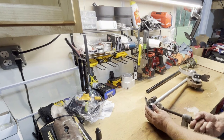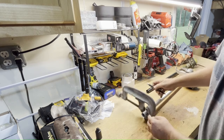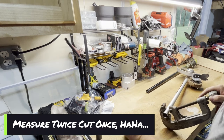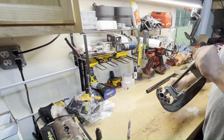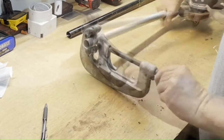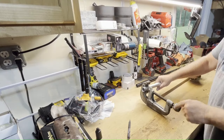I put my fingers at the end where the tube was, measured down, and made sure my mark was good. Gently turn the wheel, tighten the wheel, then check my measurement again. Measure twice, cut once. Go around a couple times and make sure it doesn't corkscrew — that's what I'm showing you here. Tighten the wheel down slightly a couple more times and make sure you get that groove going. Don't crank the wheel down all in one shot because you'll mushroom out the end of the tube.